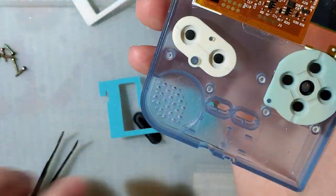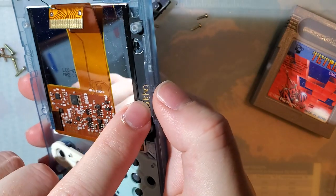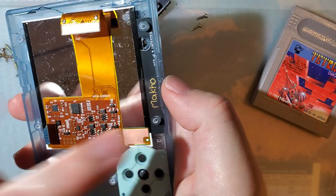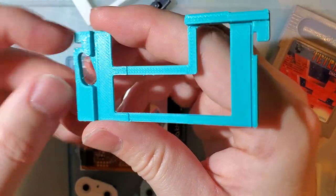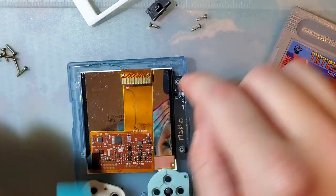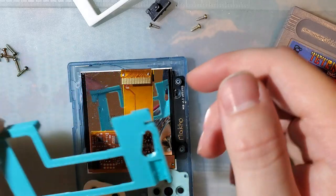Otherwise, I'll go ahead and throw a link to that and we should be good to go. If you're watching this video to see how these brackets work, you just drop the bracket in and then place the screen in there, lining it up against the bracket. If you're using the Retro Modding bracket, you can attach it to your screen with a small strip of double-sided tape here and here, and that'll attach the back of the screen. Then you can line it up from there — just make sure you do the actual shell trim properly, and then continue with your install like normal. Thanks for watching guys, have a fantastic night.